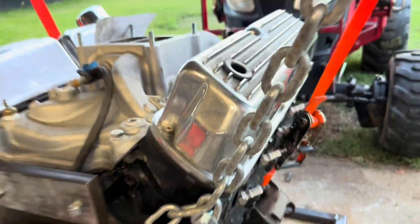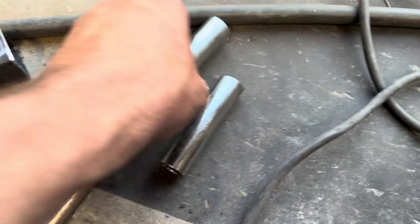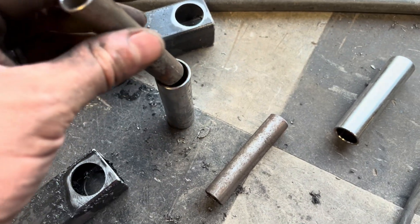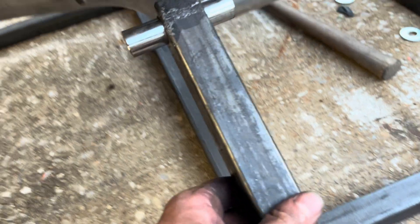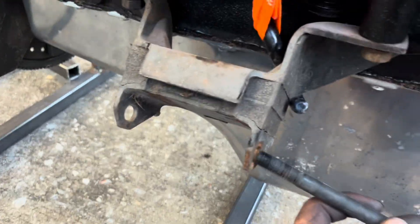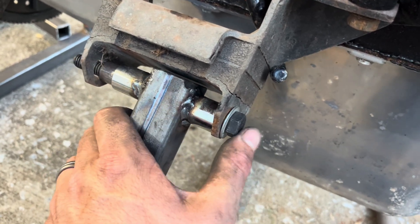I've got the engine in place — of course that's where my mount's going to go from there up to there. I found this little piece I had sitting around and now working on the engine mounts. These right here are going to go through this piece, be welded, and they're going to slide right down through the top just like so, and a bolt will go through there. Once welded they'll go right up into place right through there. Now I've got those welded all the way around — I can take my sleeve and slide it in, and right there is the engine mount.